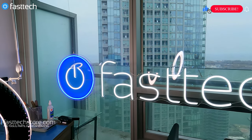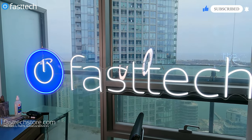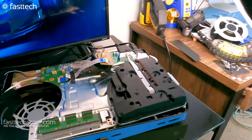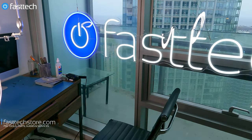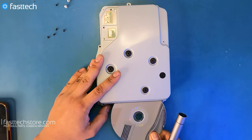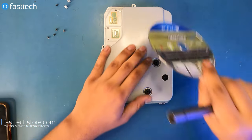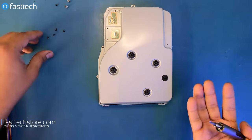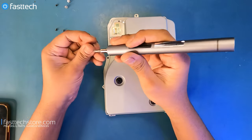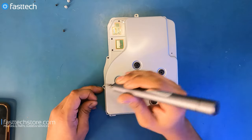Like the video guys. Subscribe to the channel if you haven't already. Check out our website at FastTechStore.com if you need any PS5 parts including disc drives, power buttons, fans — you name it, we got it all. FastTechStore.com. Now, when you're testing, make sure you put the disc in like this — it might seem like it's supposed to go in one way, but it really goes in the other way, because the laser is facing downwards. I'm telling you this at the expense of looking silly because I don't want you guys to waste 10-15 minutes figuring this out the way I did.